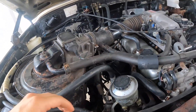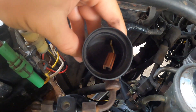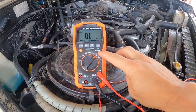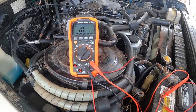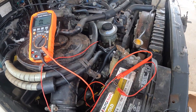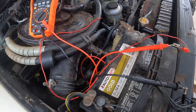In my previous video we had the mechanical gauge — we've removed that. There's our sender. It's got two spades on the top, and here's our wire — just one single wire, yellow with a black stripe. We've got our multimeter hooked up on the ohm range in the auto-ranging feature. We've got our black cable hooked up to the ground post of the battery, and our red test lead hooked up to our sender.